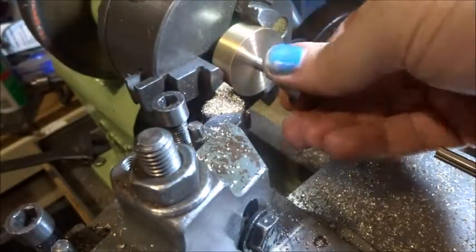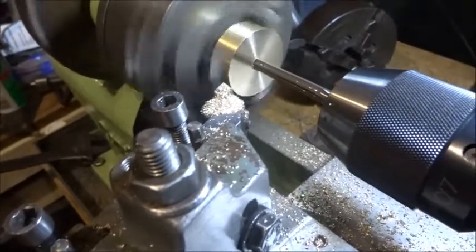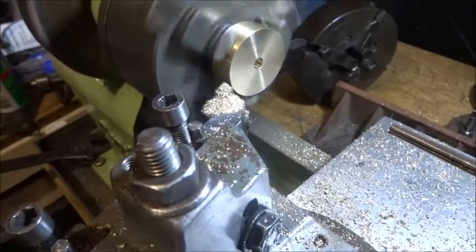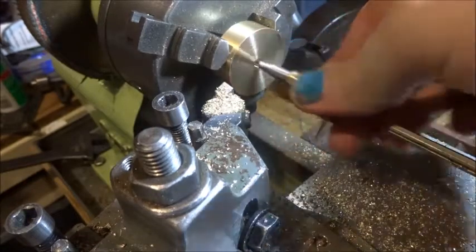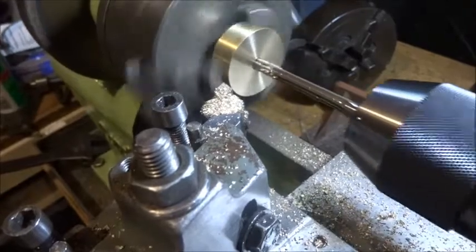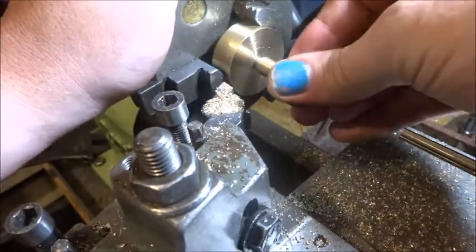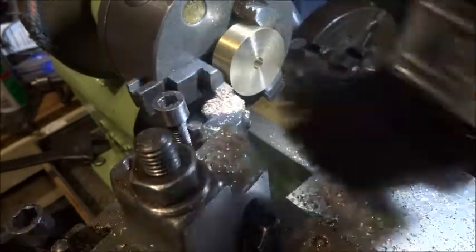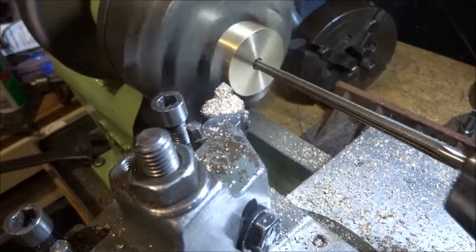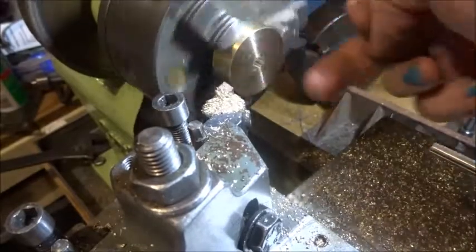So just slip this bearing and crank out of the engine. I guess we want to push that in until it just has the right amount of end float, so we'll go a bit further. It's getting really close — just a fraction at a time. It's still got a little bit of end float there. Get everything nice and clean. If push comes to shove and we go a little bit too far, we can easily take a bit more off it.